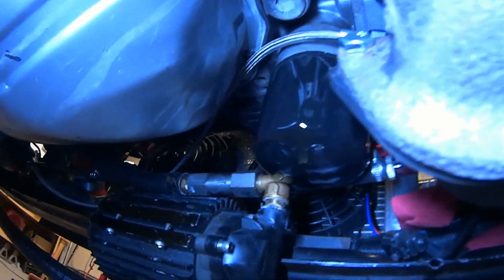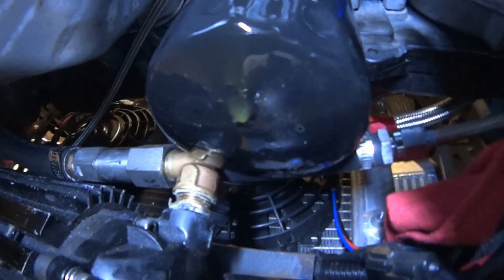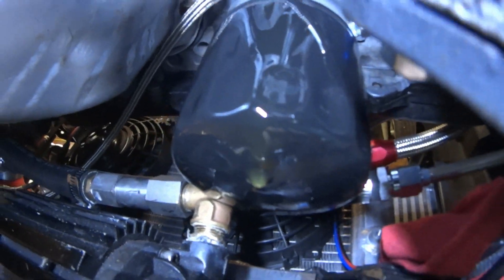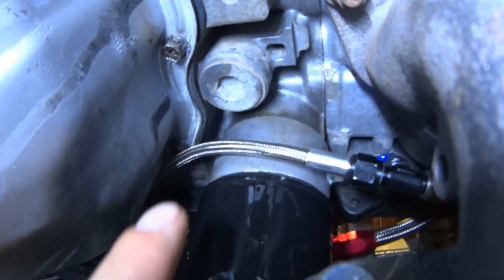I just had a kind of funny experience — I was putting engine oil in the engine trying to get it ready to prime the system. I started putting oil in the oil cooler hose figuring that would prime the oil filter and the sandwich adapter area where the turbo feeds are as well. And I heard oil pouring all over the ground, so I assumed I had made some sort of hose incorrectly. Let me show you what I saw when I got under the car. Here is the oil filter and there is the oil sandwich adapter, and oil is just pouring out of the side here.